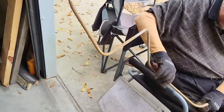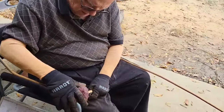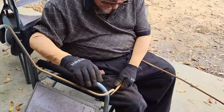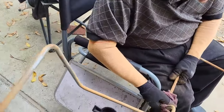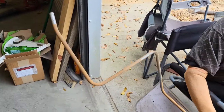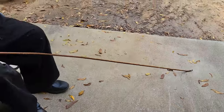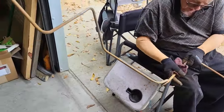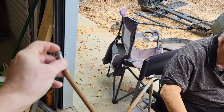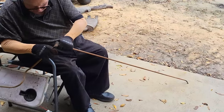All right, the other thing we're going to work on with the fuel system is we got the old fuel line out and it's in pretty decent shape, a little bit of surface rust. So we're gonna go along this thing, clean it up as best we can. We'll treat it all, make sure that it stops any kind of future rust. And then that'll be ready. We're gonna put some cleaner up through the inside of it and clean it out real good. And then we'll have our feed line.